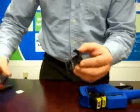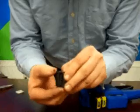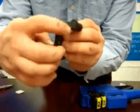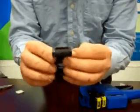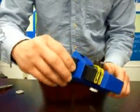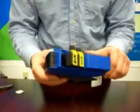When you get your new ink roller and want to put it in, slide one side in first, then gently get the second side in so that the tabs are inside of the inker assembly frame. To put it back in, simply place it back in position and push down until it snaps back into place.